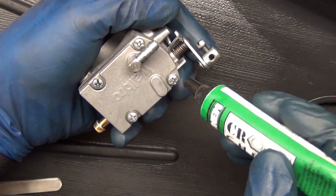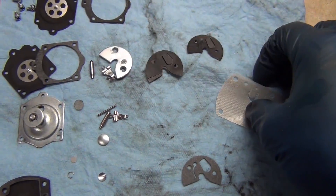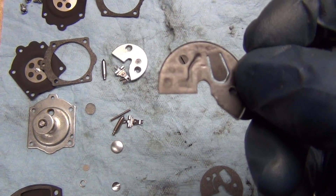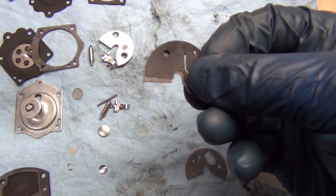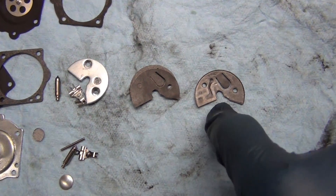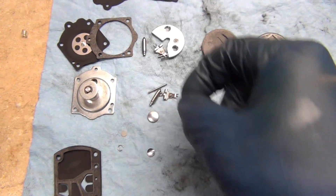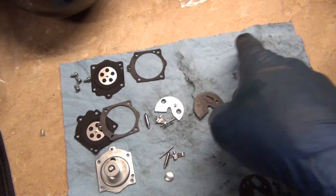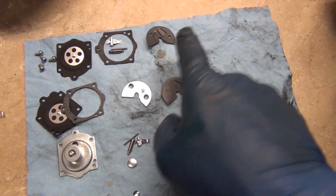If I'm doing one side I'll just do the torque paint now, but I'm going to save it for the other side so I don't get it all over my hand. I just get everything laid out the same. You can see how this material has collapsed down into the gasket — you see the gasket on the other side, and how the new one's just perfectly flat and nice. That's the new carburetor feel versus the old worn carburetor feel. Ethanol gas really helps get that happening. So this is all just old strainers and parts — old ones across the top, new ones down below.